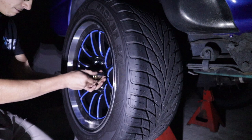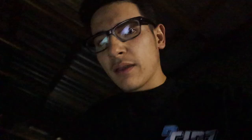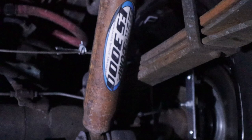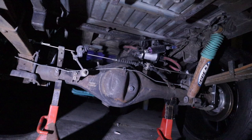Good to go. Once I lower the truck I'll torque them down to specs, just like I always recommend you guys to do. I'll show you guys how it looks - the setup in the back, you can see I got my lines right there, using all the factory stuff. I think the next thing I want to get is shock absorbers. And like I mentioned in an earlier video, I'm going to be powder coating this whole rear end. I also need to do all the undercoating under the truck before I get any more surface rust - I want to protect it as much as possible.